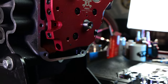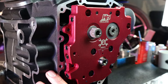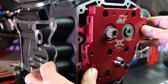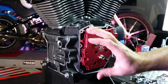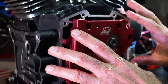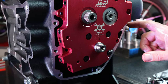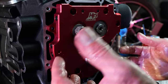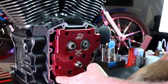Plug o-ring on the back of the pump, o-rings on the engine case, flats are lined up — we're ready to go. A little trick I like: you can use your thumb or finger to push on the oil pump to help pop that scavenge port into place. The reason we like doing this as a complete assembly on the bench first is that you're only going inwards toward the crankcase. The factory method — putting the pump in first and then the cam plate — ends up pulling the oil pump back out, which can sacrifice the seal on the back of the oil pump at the scavenge port case.